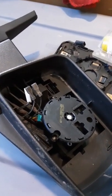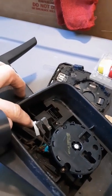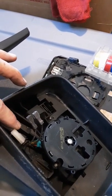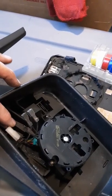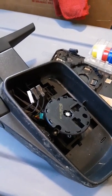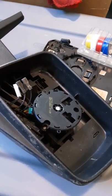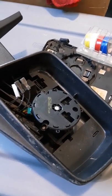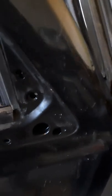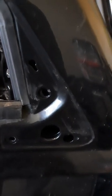Maybe in the future we'll get a piece of glass that has all these connections. But for now I'm going to tape over the white connector here to prevent any moisture from getting in. But we'll be able to use all the motor mechanisms and have the memory functions of their mirror presets. I'm going to start assembling it back together in reverse. I'll line up the clips with those eight slots inside that mirror head. Wipe down the area, make sure there's no damage to the mating surfaces, make sure the gaskets are good and intact — no damage, no rust.